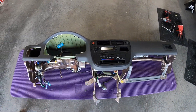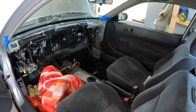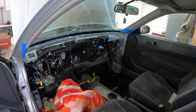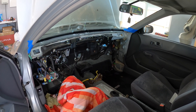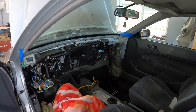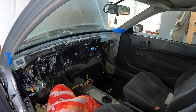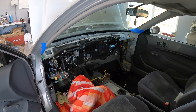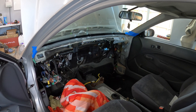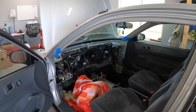Got the dash ready to go with my bolts in place so I can hopefully do this by myself. The only plug affected is the blue one right there — that's for the heater and it's no longer there. Everything else remains where it's at, and once the dash is in it gets plugged back into the mounted fuse box. I'll put this on time lapse so you can watch me struggle with some fun music.